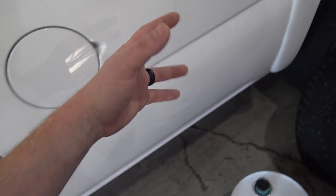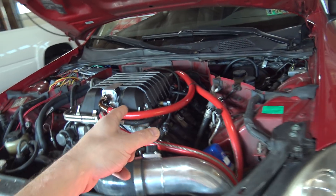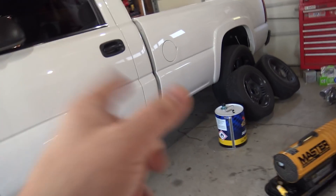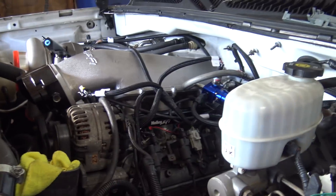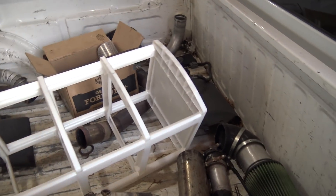Once the truck gets running, there's a 400 or 450 pump in the tank — I'd have to confirm which one. I have another 450 stashed in the fuel cabinet, plus the AEM 320 or 340 out of the G. I'd like to take the bed off once and install all three pumps. Part of me wants to test how far the truck goes on the stock feed line, since we've pushed them far before but never until fuel pressure dropped. Three pumps should be plenty of fuel — the feed line would be the limiting factor.